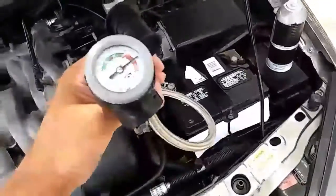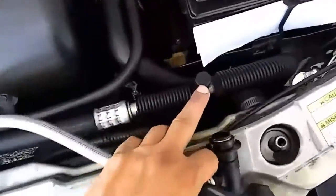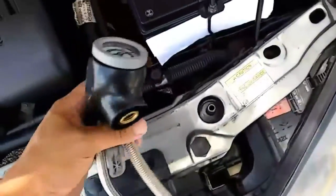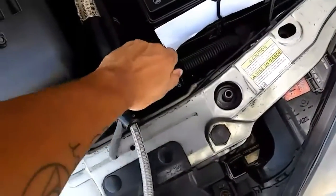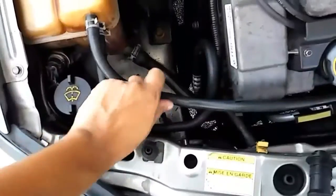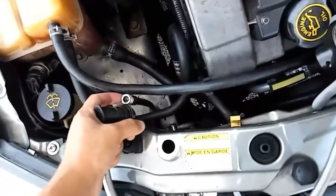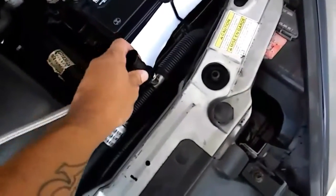Let's begin. You'll connect your PSI gauge to an AC service port. This is the low pressure AC service port, and this is the high pressure AC service port. You want to connect this to the low pressure. Now, each fitting is different, so even if you think you're going to do it wrong, you can't — because this will connect to the low pressure easily. If you try to connect it to the high pressure, you can't, because this is too big. So you can't go wrong. It's error proof.